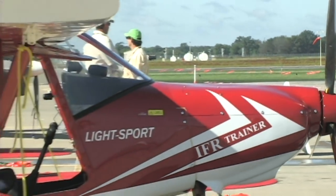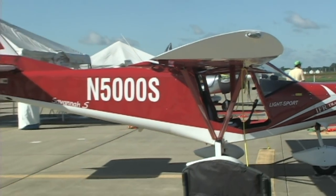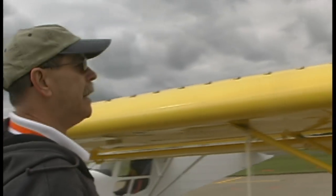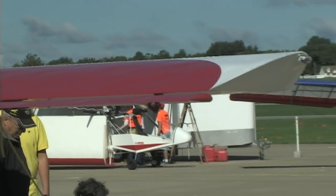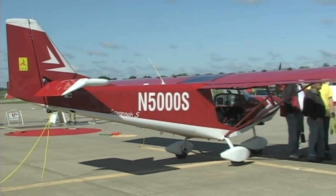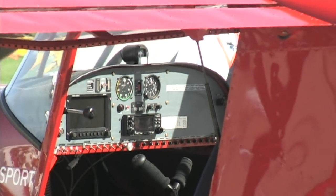It has a little longer nose and a little wider cockpit. All these little black things up here — little pieces of plastic — do some real magic. We've heard of vortex generators, but it amazes people how a piece this small, arranged all the way along the leading edge of the wing, can make this airplane take off and land even shorter. Though this appears to disturb the airflow, what it really does is make the air hug the wing better, so you get better low-speed performance and helps make the short takeoff and landing characteristic that much more solid.